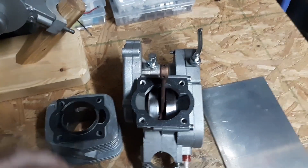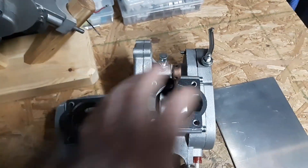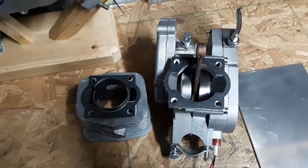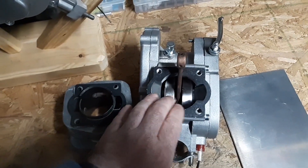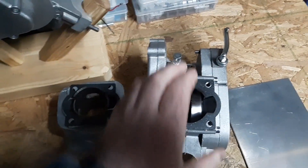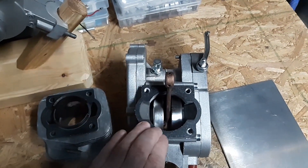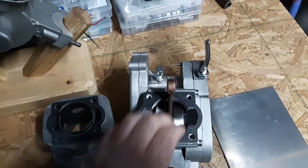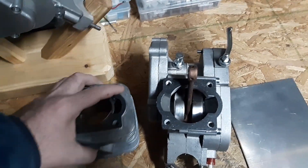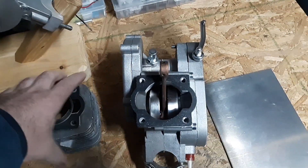So I watched the recommended videos you guys told me to watch about this 110cc and it had me rolling on the floor. It was like watching a kindergartner finger paint — I thought it was hilarious. When you don't have a bottom half with the correct geometry to run the cylinder, everything is off to run a 40 millimeter stroke cylinder. The height's not right, the stroke's not right — of course it's going to have terrible port timing. You don't have to dremel the hell out of the poor thing. That's a cluster.